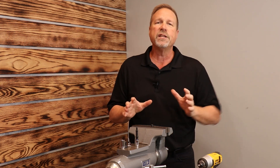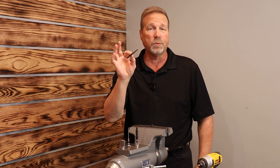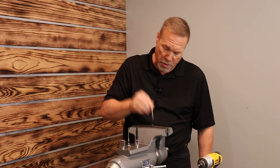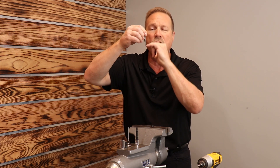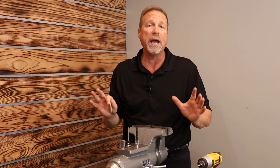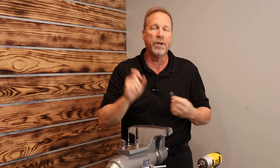There are a few things you've got to know about extractors. When you're talking tapered extractor — a spiral or a four-sided fluted like this one — the drawback is that when you drill a hole and bang this in, you're only getting bite at the top leading edge. Everything from that part of the cone down is not making contact with the cavity, so it has a very small bite print. Typically, as you apply torque, they just chew the top of the cavity apart because they don't have a real good bite.